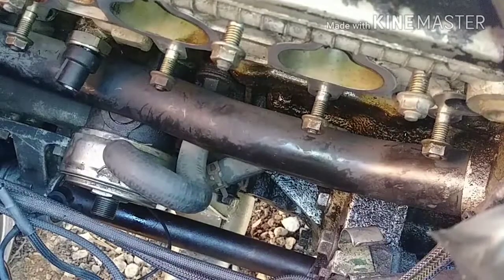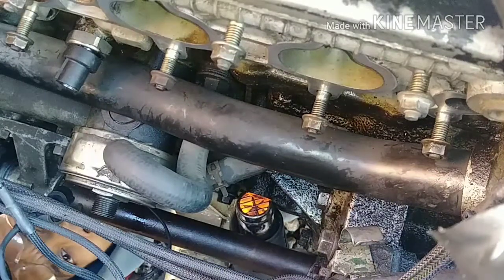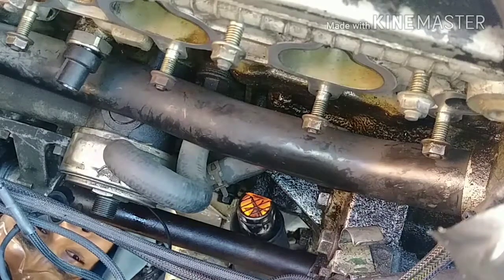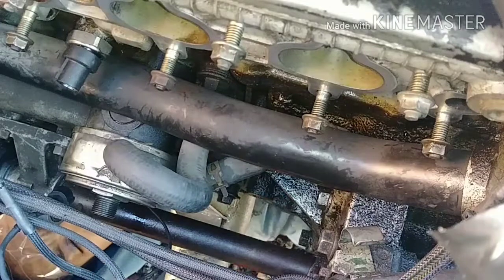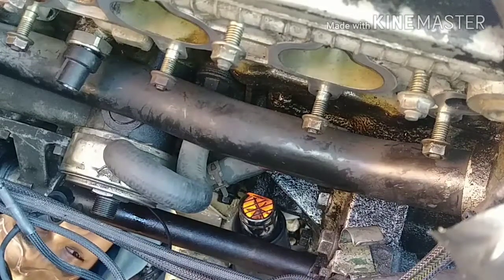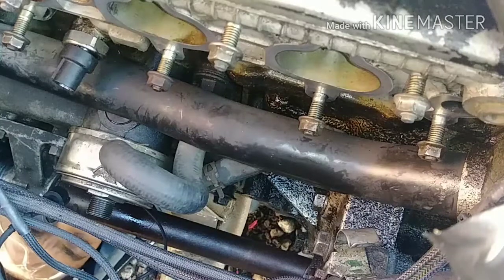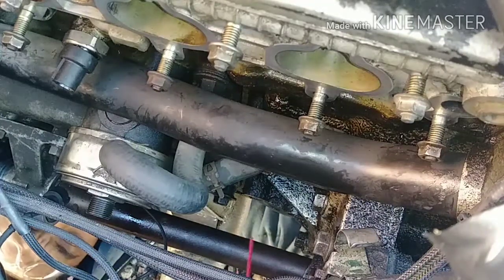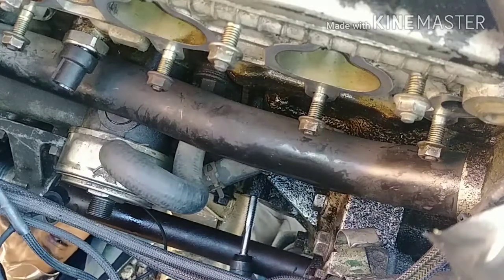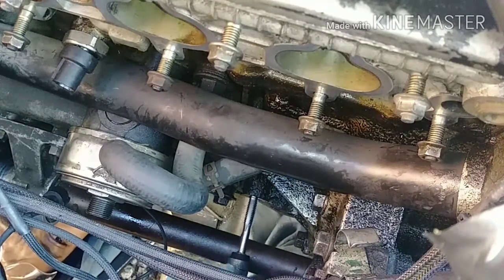All right, so now I'm gonna start with heating this thing up. And be careful of any wires. I just wanna get this block at a decent temperature. It is a tight fit in here. It is a very tight fit in here, so just bear that in mind. And I am using the 3/8 tap piece. What I'm gonna do is spray some WD-40 on it, and then slowly try to get it as straight as possible and work this thing in here.